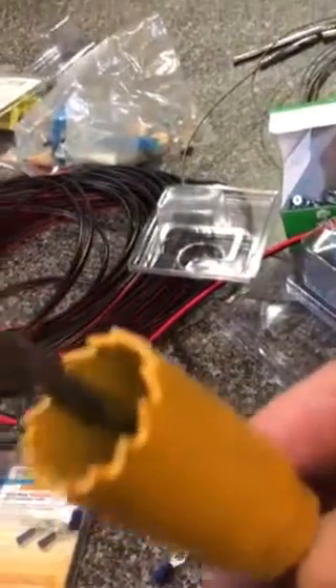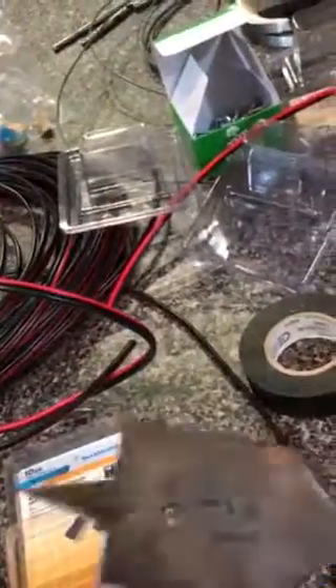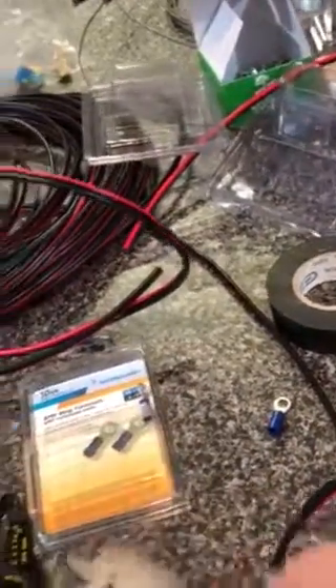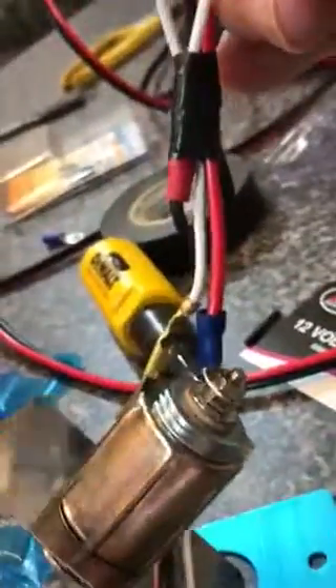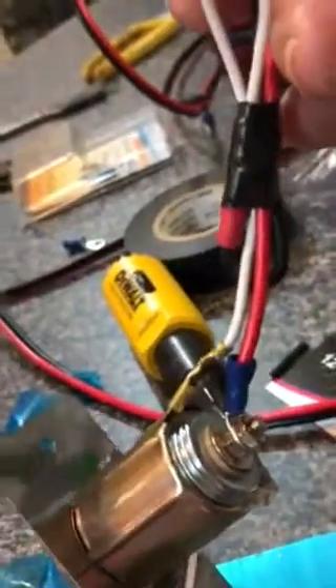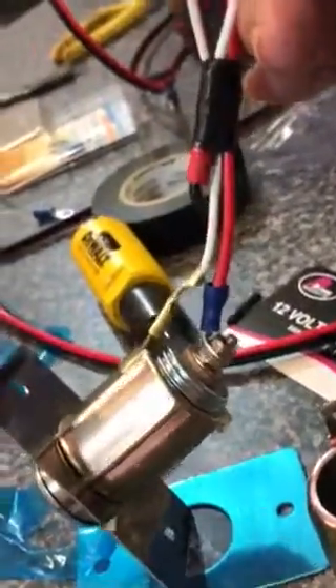The 1 1/8-inch is perfect and the hole saw works better than the other drill I was using, which ended up really digging into the insulation and I didn't like that. So if you look over here, this is for the next hole — I've got the negative pigtailed into the black wire and then I used a fitting for the hot wire.